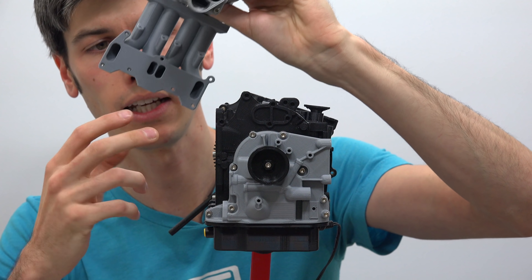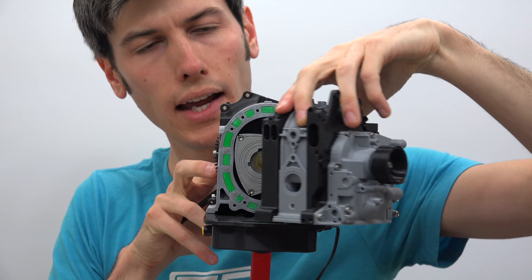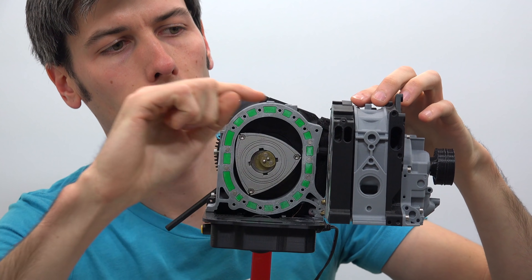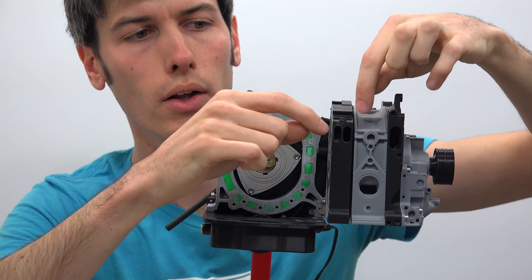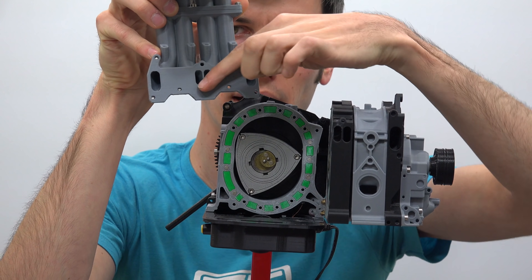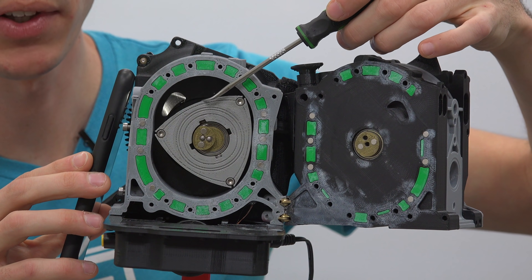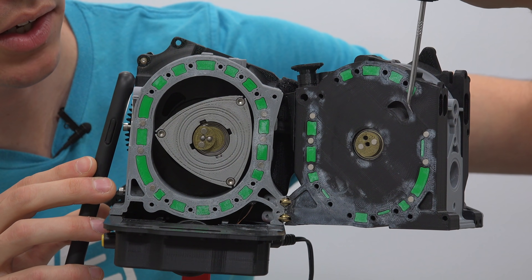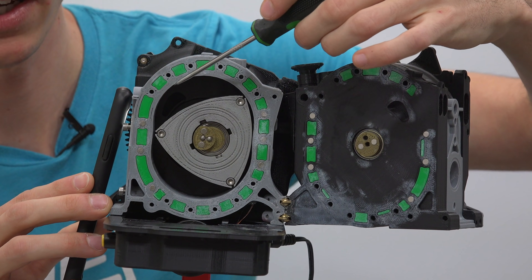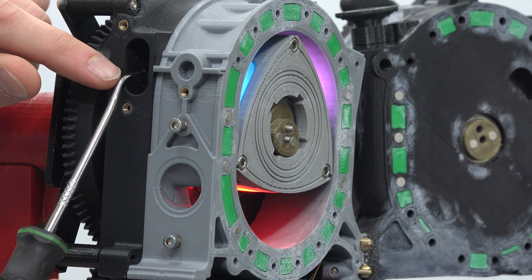You can see there are two ports on each side — each rotor housing has two ports of air coming in, bringing air on the left and right side of the rotor. If I rotate this out, you can actually see those ports there. There's one port on the left side of this rotor that feeds in air on that side, and then another port on this side which feeds in air on this side of it. So you can see there are two here in the middle — it splits, and one feeds air to one rotor, one feeds air to the other rotor. Looking inside the rotor, you can see that intake port where the air comes in as that rotor rotates. You've got the same thing on the other side — the air will come in right here and be pulled in as this rotor rotates, creating a vacuum pulling in that air through the intake port on both sides.